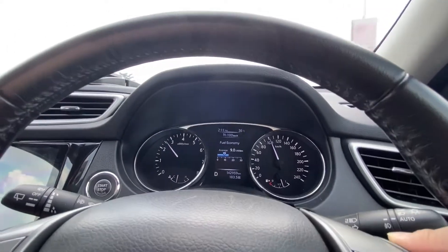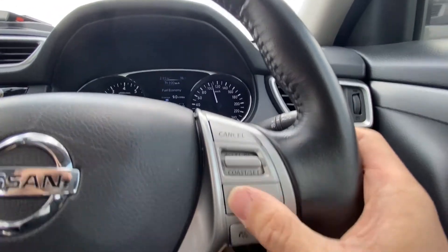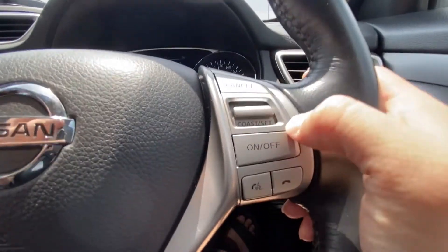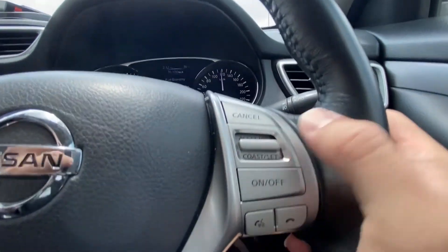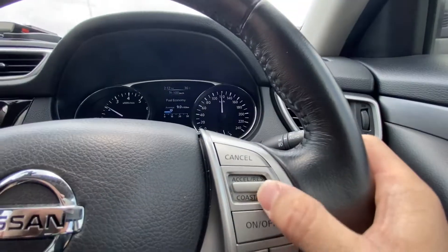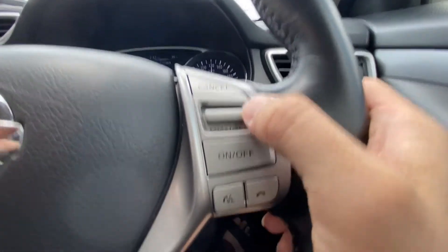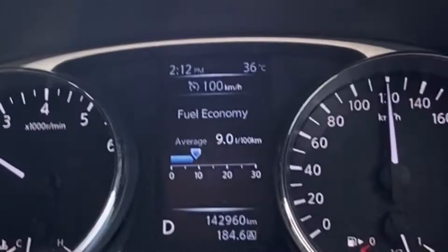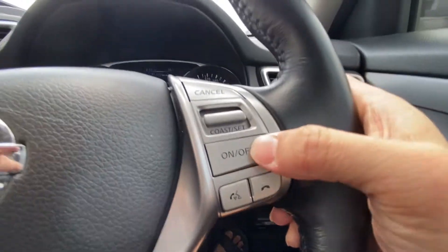So that's it — these are all the buttons you need for autocruise. First, press the button, then push the lever down to set it, and it's ready to go. After that, you can adjust the speed by pushing up for faster or pushing down for slower. You'll still see the 100 displayed, but if you're not using autocruise you can press 'off' to clear it.